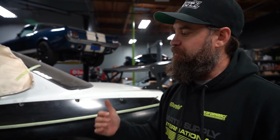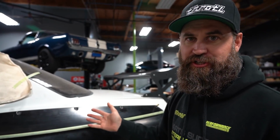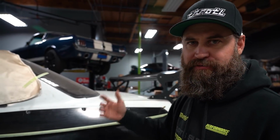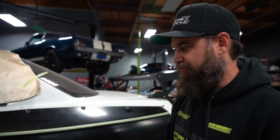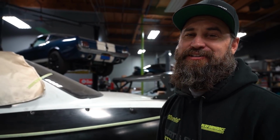Now what we're going to do, like we typically do, is go back and put metal back in, so we make it nice and smooth. That way if our tire ever contacts that, which it shouldn't, we've taken careful consideration to make sure we've got just a bit of gap so that we can roll with this thing all the way down and hit small bumps. We're obviously not going to be rolling on the freeway with it dumped like that, so we don't have to worry about it too much. We want to put a nice coat of steel back in there and reseal everything with seam sealer and panel bond, and this thing is going to be slick. It's going to lay out and look badass. Tomorrow morning, we're going to get cranking on the other three corners and knock out the rest, and then this thing is off to paint.